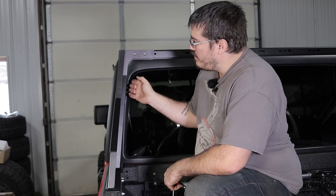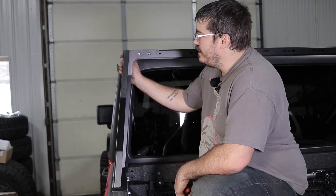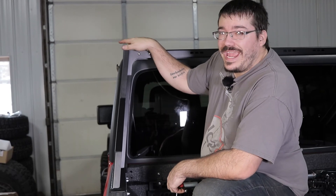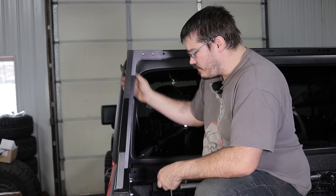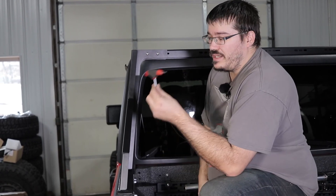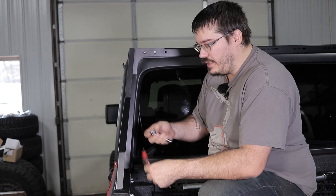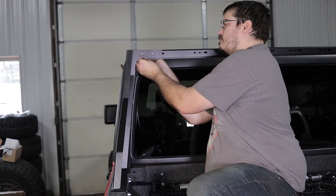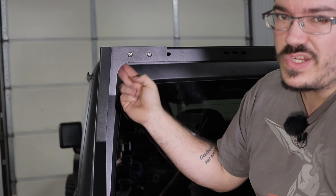For the side-to-side positioning, what we aim for is to basically match the angle of the hardtop. You can go in or out just a little bit depending on how you like. There shouldn't be too much gap up inside on the rail when you have it fairly centered. You're going to use a 3/16 Allen to go ahead and tighten these button heads up. If you have a t-handle it may not fit in the front, so you'll need to use a shorter Allen or just a socket. As you're snugging these up, if the nut wants to turn a little bit, go ahead and just hold it with a half inch end wrench.